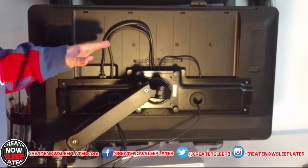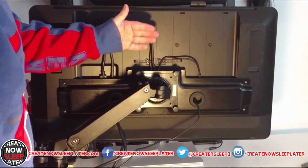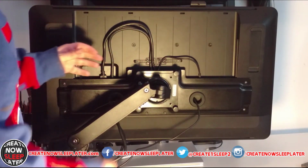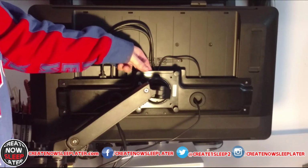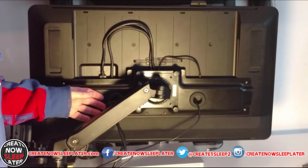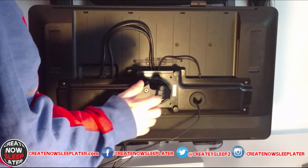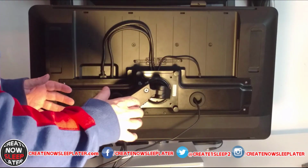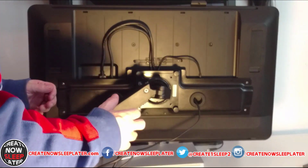So just in review, you're going to line up your cables first. You're going to attach them to the Cintiq, put a little tie there at the bottom, test the engine or the back cover, with that little tie down at the bottom before you put this Vesa mount on. Put the back on or the Cintiq engine. Then you're going to have this thing, like I showed before, on a couple of pillows or something really light, and then you're going to stick the Vesa mount. That'll be the last step.